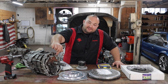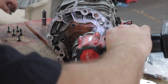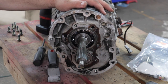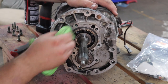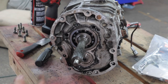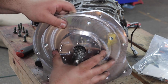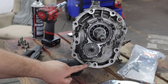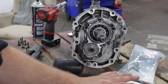First we need to remove this piece to get the adapter plate on. I want to make sure this surface is really clean. There was a paper gasket on here from the factory, but XAT Racing recommends using RTV silicone. With the RTV in place, we can install the adapter plate. The dowel pins on the transmission are interfering with the plate and not letting it sit flush, so I'm going to try to remove those.